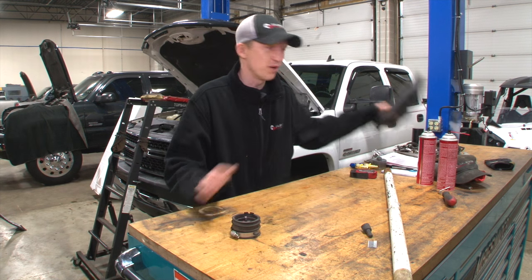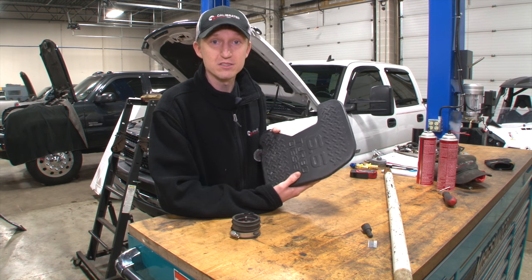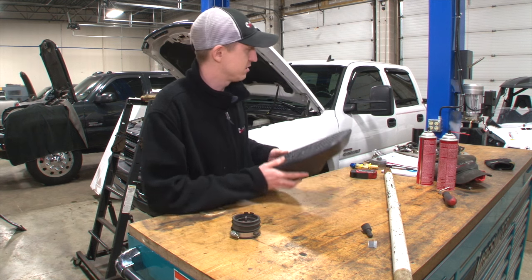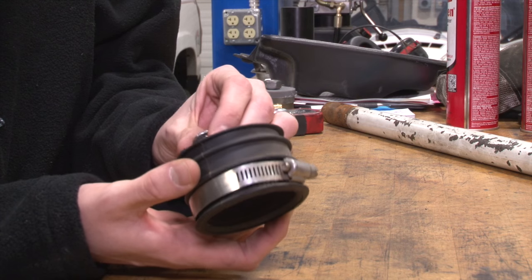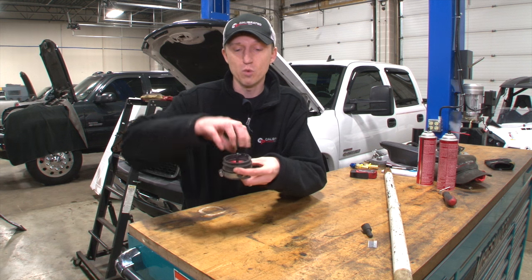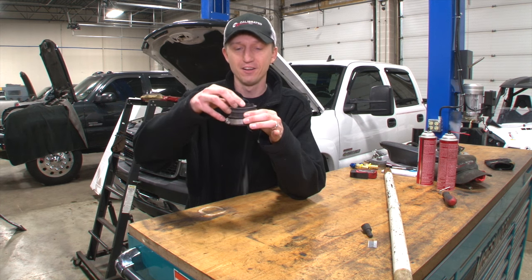After digging into it, we found out that he deleted his resonator, which pretty much every Duramax owner does when they first get it because it's a cheap easy mod that a lot of guys do just to clean up the engine bay. But what he did was put a setup on it that uses a wing nut to cover that port, and once the wing nut rattled free, the bolt dropped into the turbocharger.